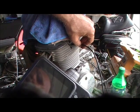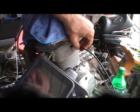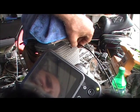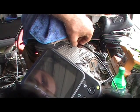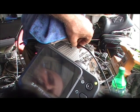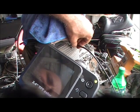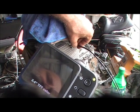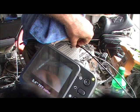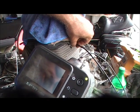Because you see that story right there that I'm seeing? I don't mind that there's a little carbon on top of the pistons. But I do mind that it had that melted spot. And I've got pieces of rings showing through there.